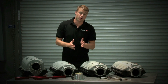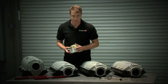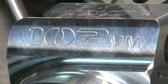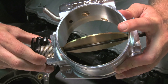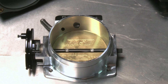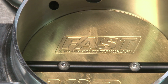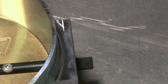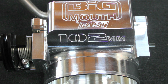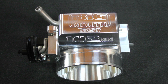Now speaking of throttle bodies, FAST's Big Mouth comes in both 92-millimeter and 102-millimeter sizes. Both cable-drive throttle bodies feature an offset blade pivot for improved throttle response, a thicker blade and shaft to resist deflection and binding — especially in boosted applications — and a modified internal design for reduced turbulence and better flow, especially at part throttle. FAST recommends using 102-millimeter throttle bodies with convolute barrels for proper drivability, which is exactly how FAST designed their Big Mouth 102-millimeter throttle bodies to help with that low-speed drivability.